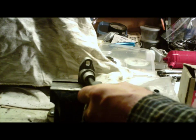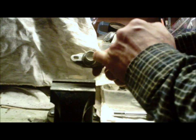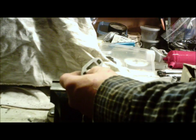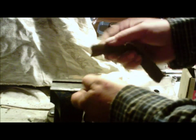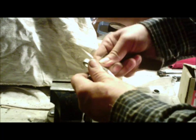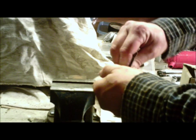So we finally got that open. You can go straight through there now with your finger even — that's nice and open. After, you might want to go in there with a little bit of plumber's tape, which is this stuff they sell at the hardware store. It's a 220 cloth, nice long tape — this works really dandy. It's aluminum oxide, so it'll pick up the aluminum rather nicely and leave a good finish. Just smooth it all out in there — the less lumps and bumps in there, the better.